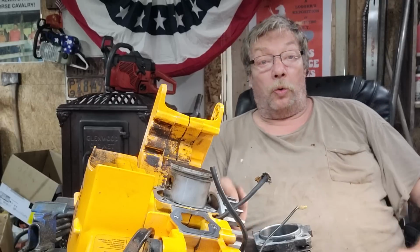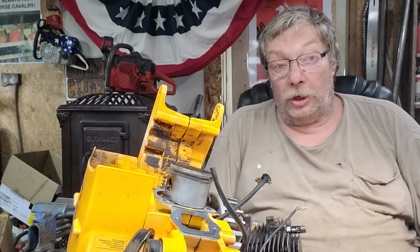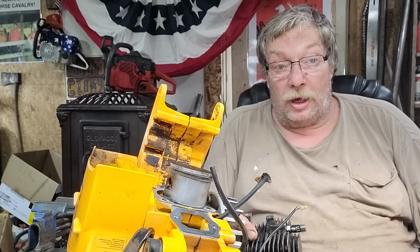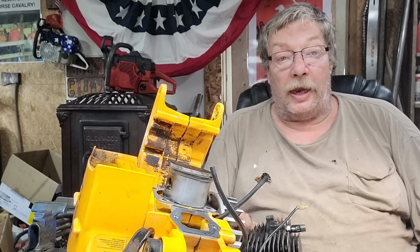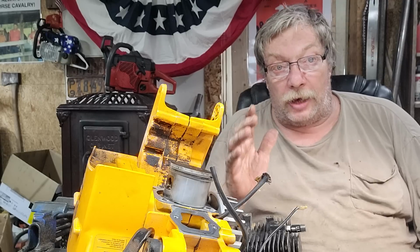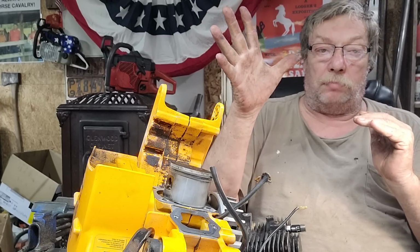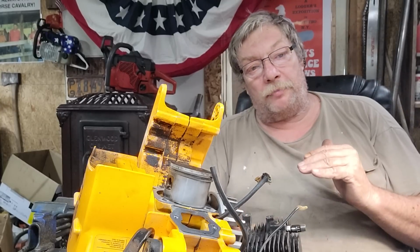When you raise your transfers, your cylinder's like this, and you raise them up, I'm going to warn you, you're going to reach one point there where you start making it gag. You're going to start mixing exhaust gases with your intake air-fuel mixture, and it just goes downhill from there. It has to have time for the pressure to come out, and then when the pressure drops most of the way, it doesn't have to be all the way, but most of the way, that intake charge, them transfers open, boof, and it blooms, and it forces the rest of the exhaust gases out. Piston hits bottom dead center.